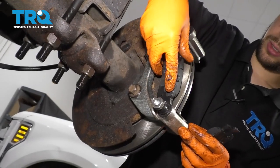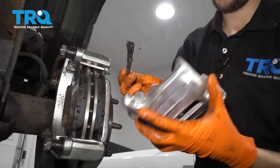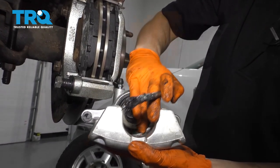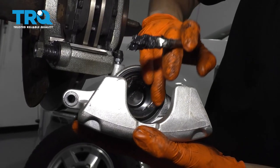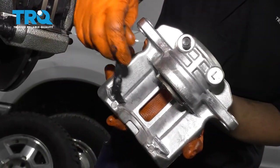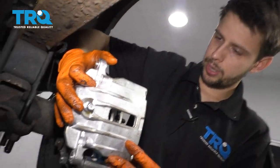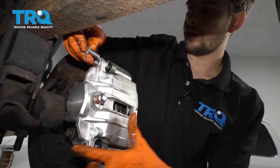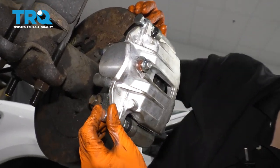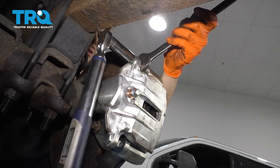Next, take your brake pads and slide them on the caliper bracket. Make sure they slide on all the way. Then take your new caliper and add a very thin layer of grease right onto the outer ring of the piston — just a little bit to prevent the pads from making noise and to create a watertight seal on the inside of the piston. Add a little bit to the two ears as well to help reduce noise. Mount your caliper, push the sliders in top and bottom. Take your new caliper bolts, start them on, bottom them out, and torque to 31 foot-pounds. You may need to hold the slider with an 18 millimeter wrench so it doesn't spin while you torque it.